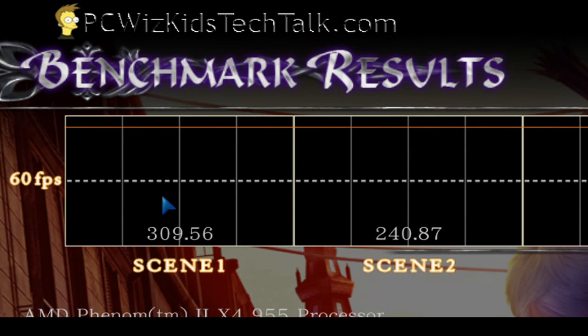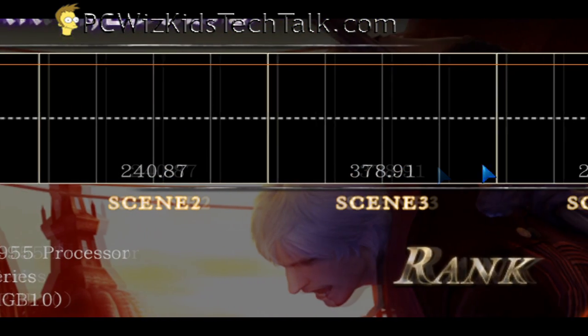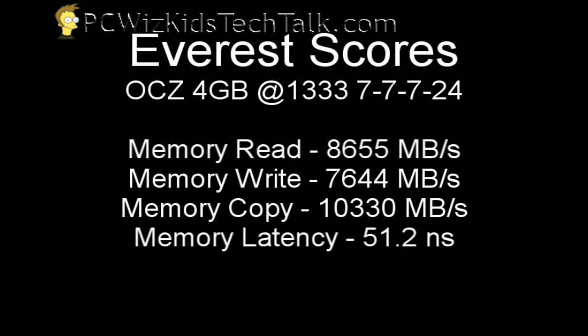When I ran the games — I ran a whole bunch — you're really only getting about 5 to 10 frames per second more with the OCZ compared to the Kingston. On Devil May Cry 4 and Stalker, I ran the same benchmark twice with both RAM kits. It's only 5 to 10 fps more with the 4GB OCZ. So if you're into gaming and want to squeeze out as many frames as possible, the OCZ will give you more for the same price.